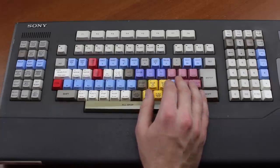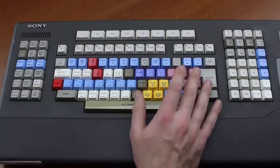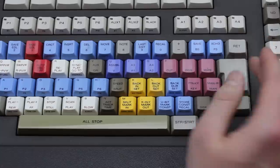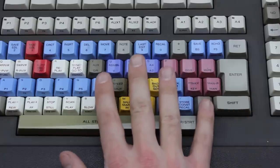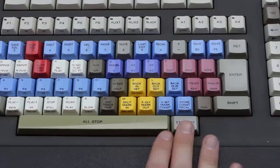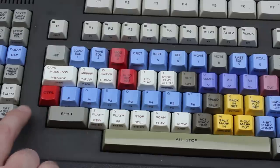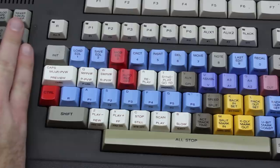The layout is also rather unusual, although it's still got a staggered QWERTY base, so unlike last week's Tele keyboard you could probably use it as a normal keyboard. It's got some typical Japanese traits, such as a 1.5-unit extended right side with an ISO-style enter key, a 1.5-unit backspace — or rather RET key — as well as a split right shift on the inside, which means I keep pressing the wrong key when I want to press shift. Note also the rather depopulated bottom row, the lack of alt keys, let alone Windows ones, and the board has been extended by half a unit on the left side as well.